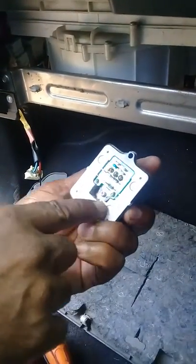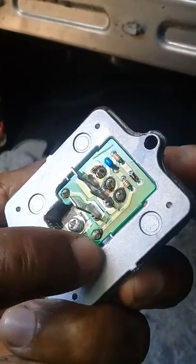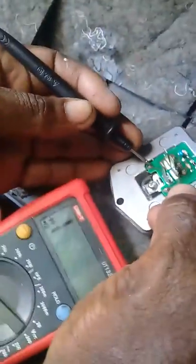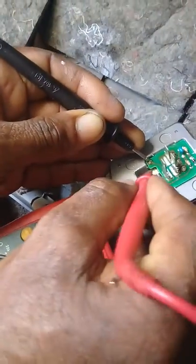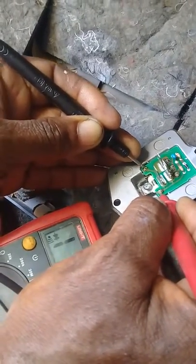This is what it looks like on the inside. Now, there is a FET there, but there is a thermal resistor right here. It blows from time to time — it goes bad. It can be changed, or it can be bridged out if it is the source of the problem. So we put our meter on the ohm scale and we do a continuity check across this thermal resistor. As you can see, there is nothing happening on my meter — it's dead. So this thermal resistor right here is open. So we're going to bridge this thermal resistor, and that should rectify this problem. It's the same on the Honda as well.